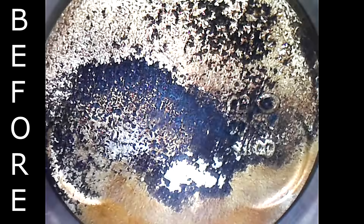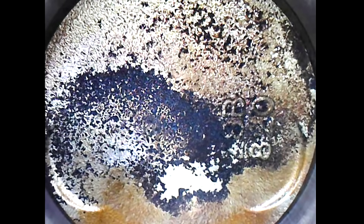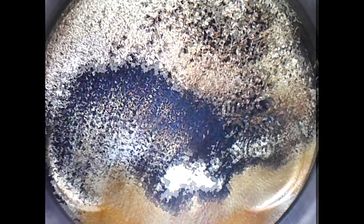We're going to have to see the before and after because it's hard to tell if it got any cleaner just by looking. Here's the before and after — the before is the first time we ran the seafoam through, and the after is the second time. You can see there was more cleaning of the carbon at the top right, and also a little bit more carbon got cleaned at the left valve indent. So there was a little bit more cleaning, but it didn't get it completely clean.